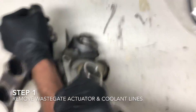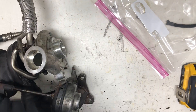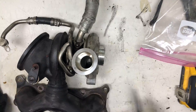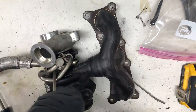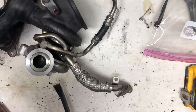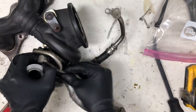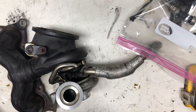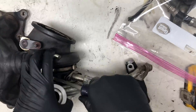The first thing you want to do is remove all unnecessary parts of the turbo — we obviously don't want extra gizmos while we're working on it. The bolts come off pretty easily, and the clevis disconnects. Getting these coolant hoses off is really tricky. What I recommend is rotating them, like I'm doing with the pry bar. When you rotate them, you can slowly loosen them up and eventually break them free. You'll notice all sorts of corrosion on the seal — it seizes together quite easily.